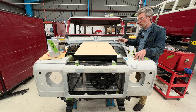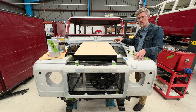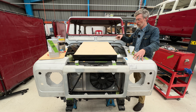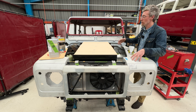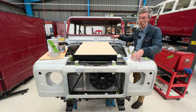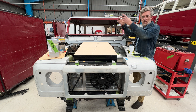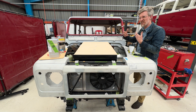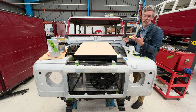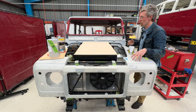This would have been a V8, but as far as we can tell it was modified by the previous owner and they put an Isuzu diesel engine in — that was an option at the time, but this one was definitely converted after. We've pulled all that out and replaced it with a Tesla large drive unit in the center where the transmission would have been. It's been rotated 90 degrees, gone from a 9.9:1 reduction to about a 4.5:1 reduction. It's got a torque-biasing diff in there so we get constant output front and rear — constant all-drive four-wheel drive.